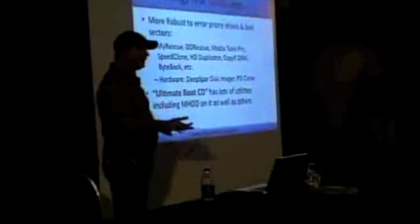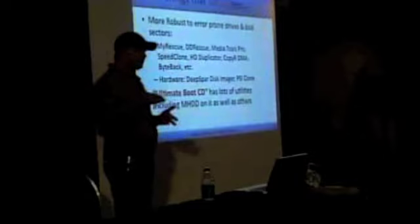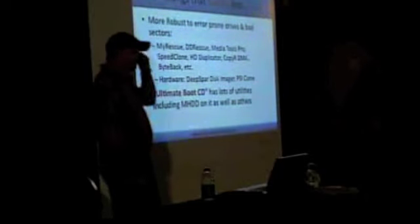Like if a drive hangs, sometimes a head will actually be reading data. It will hit a spot, and after that spot, it will never return a result again until it's been powered off and powered back on again. All those other imaging products that you've been dealing with to image sectors are not capable of picking back up after a failure, and they're not capable of turning the power off. And so they're always sequential. Almost all of them go from the lowest LBA, the lowest sector, to the end of the drive, and they don't know how to do anything else. They don't know how to just randomly start at a new location. So that's where some of your other problems come in.